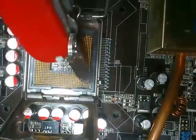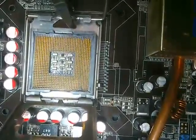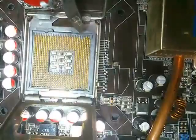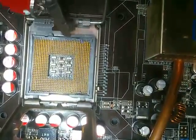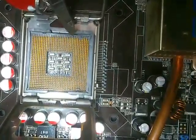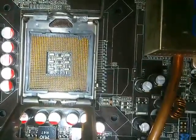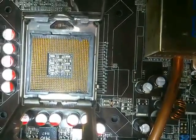Before I cut those two parts, the CPU wouldn't start. So what I'm telling you is: after cutting out those two things from the socket, you might also need to cut out a part of this belt where the sticker is on the edge of the CPU. When you cut it out, the CPU will probably lie much more firmly on the tiny legs of the socket. That's all I wanted to say.